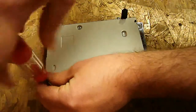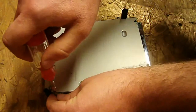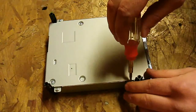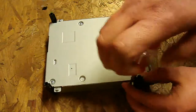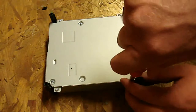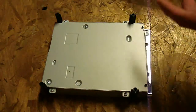The issue is that you didn't switch out the PCB board, so the keys do not match and it won't allow you to play games. A good indicator that you've done that — or if you still get that problem after doing this swap — is that it might play DVDs but it won't play games at all, or it'll say 'you need to insert this into an Xbox 360 console' even though it is an Xbox 360 game.